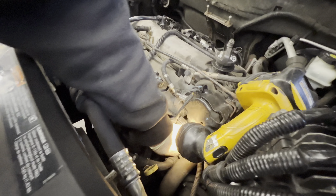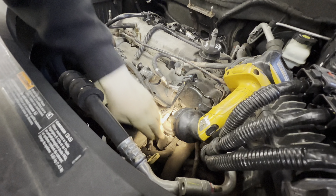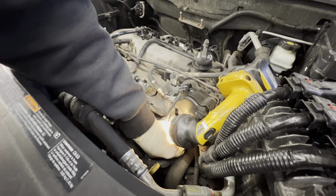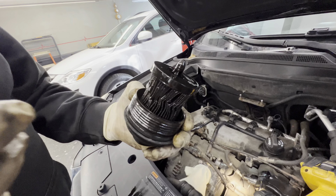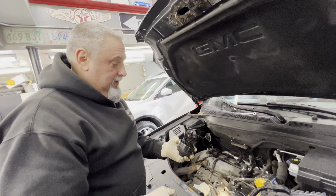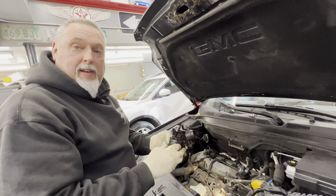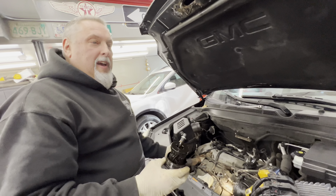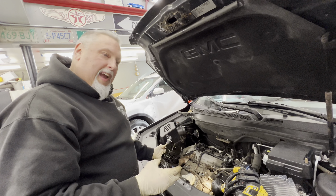Let's get this cap out of here. Oh man, look at that nastiness. This is telling me this oil filter is clogged and it's sucked in on itself because it has not been changed. Unfortunately, this is my nephew that just picked this up, and we're going to have to have a little talk about maintenance. When I asked him if he'd changed the oil recently, he said it needs an oil change — so I take it he hasn't changed the oil.